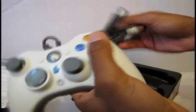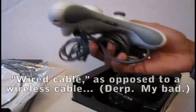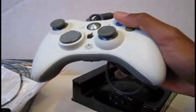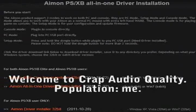The controllers, as you can see, look — no cables, right? They're wireless, but you're going to need an Xbox 360 wired controller anyway for the authentication. I'm supposed to plug this into the dongle using the wired cable here so that I can send the signal or something. It has to be a wired controller. Play and charge — that's not wired because it's still sending a wireless signal; you're just charging via cable. So you need a wired controller.